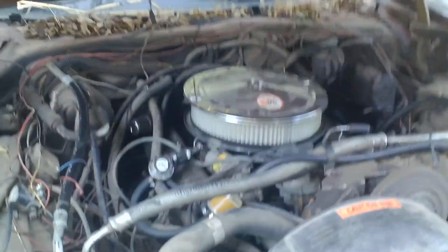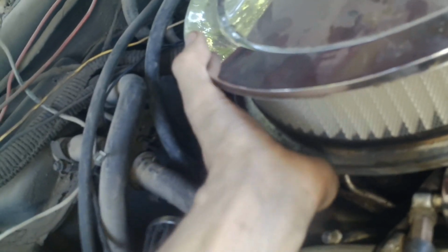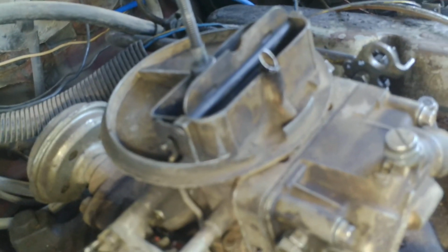Okay, so I've got this pretty much tuned up. Got my regulators set for 5.5 psi. We got clean fuel, and no more vapor lock because of that fuel pump. Set my timing right here. Vacuum modulator. Underneath here is the old H2 2300 Holley carburetor 2-barrel, 350 CFM. Hooked up except for the choke. I don't have the choke hooked up, but I don't use the choke, not in the summer. Super stock, XL super stock.